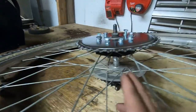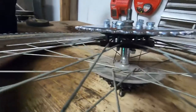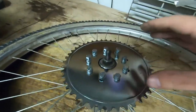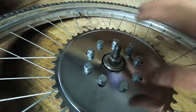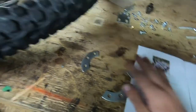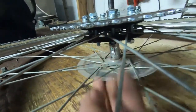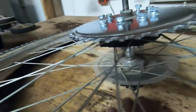What I did is I threw my inner piece — the one with the slit — down there on the inside. Then I set the other insulator, the one that goes underneath the sprocket, on top, lined it up so I had clear holes all the way through for the bolts, set the sprocket on top to line up with those holes, and dropped the bolts through so they were just sitting there. Then I reached my hand underneath and started two of the nuts just to hold it in place.